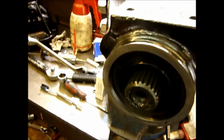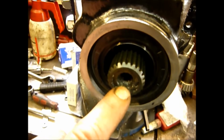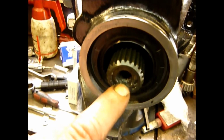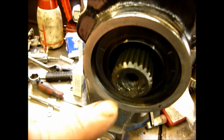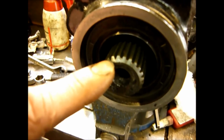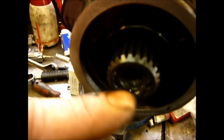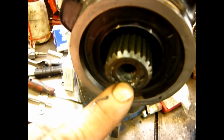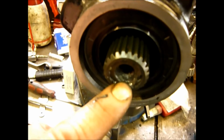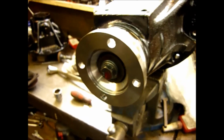So once you've done all that, what I would suggest is you blow some brake cleaner up your hole here, so to speak, or over the thread if it's having a nut or a castellated nut. Clean off the washer, a bit of black RTV sealant on here, so that when the washer goes on top and seals into there, it actually stops anything getting through the actual unit itself. And then again on this one we'll put a new bolt on it and some Loctite, and we'll torque that up, and it should be torqued between 70 and 100 foot-pounds. And there you go, all nicely fitted.